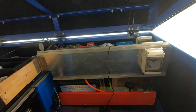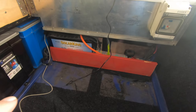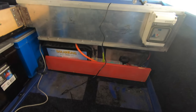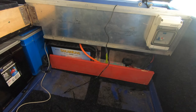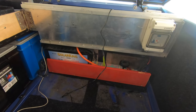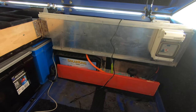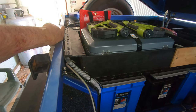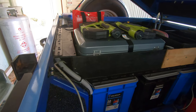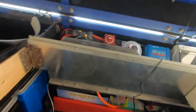Then I turn the red one off to put a new fuse in. The wiring for my batteries is just huge compared to what you'd find in a commercially produced trailer. I tend to overbuild everything electrical. My failure points are the fuses - they are my designed failure points. I counted my fuses in this trailer: I've got three down there, and four or five in that little fuse block for the left side of the trailer. They're all fairly low amp, fast blow fuses. I've got either 10 or 11 fuses in this trailer total, counting the three big ones - the two 80 amp fuses.